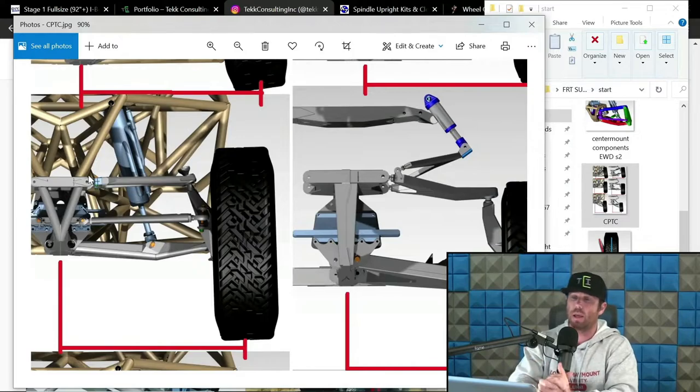Now, at compression, like I'm saying, I have seen guys that add 5. Now, adding would be on top of what ride height is. So just so that we're understanding, if I am 1 at ride height and I say add 5 at compression, that means we're going to 6 degrees at full compression.